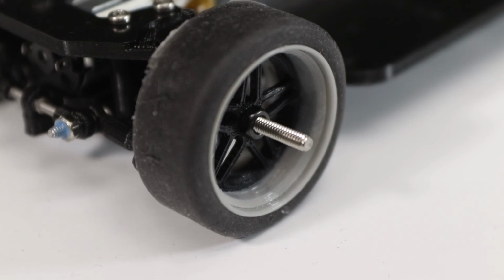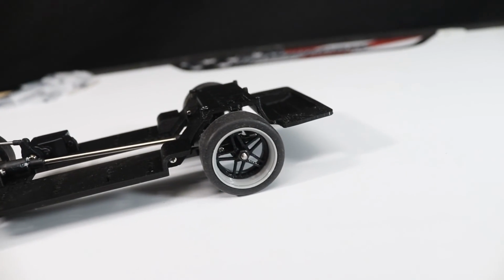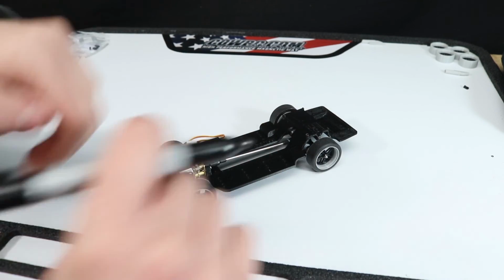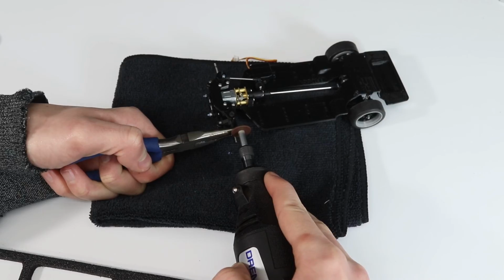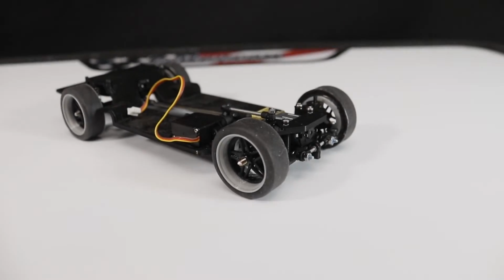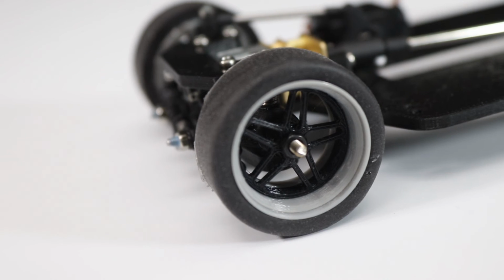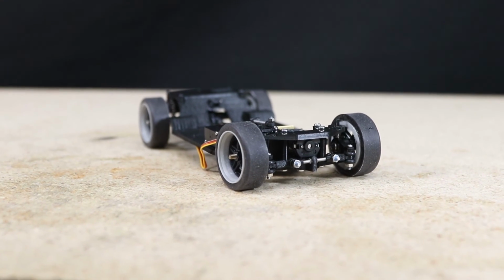One thing I still wanted to do was cut away the excess axle in the front. Although it's best to do this before you completely assemble the chassis, I carefully did this using a rotary tool. Here's a look at the finished chassis. At this point, it's ready for electronics and the body to be mounted. I'll be covering all of that in the next video, where I finish this build and test drive it.